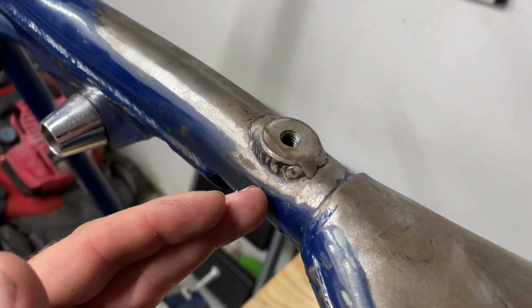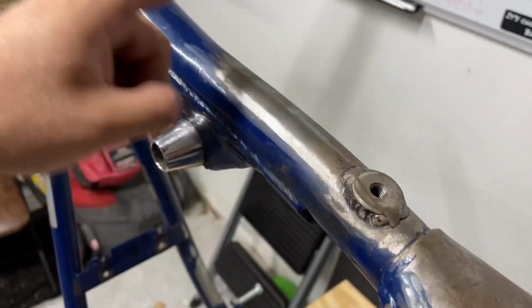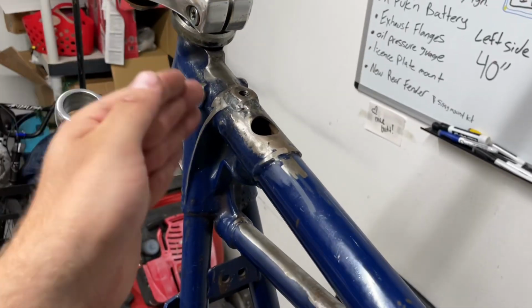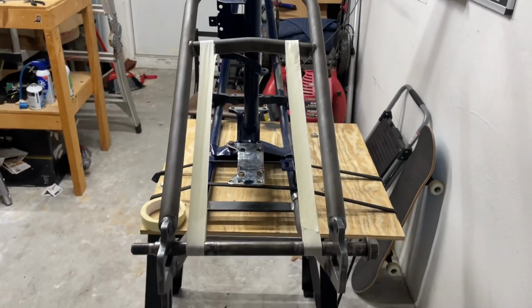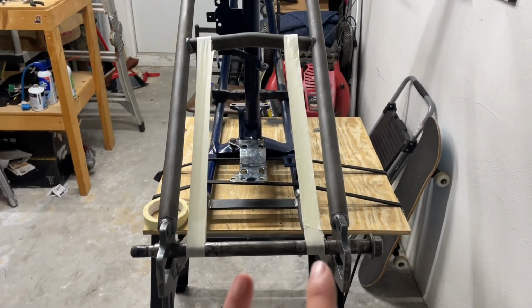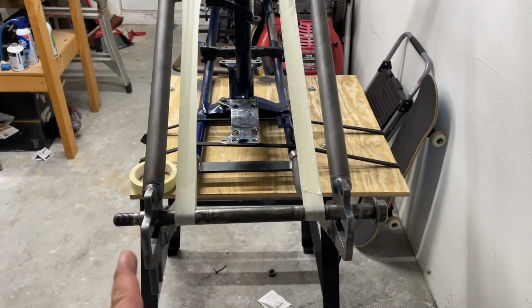And I know some frames have gas tank mounts and the original mount was cut and people welded or did something to the frame. Don't go based off of that. 87.625% of people don't measure anything. They just drill and weld. So always go off of a factory threaded area. Now what you want to do again, remove the tape for the 27th time, but you're going to want to do the same exact kind of thing, just with the axle moved a little bit.